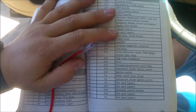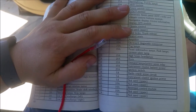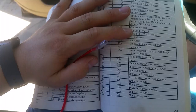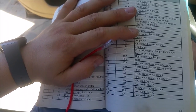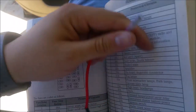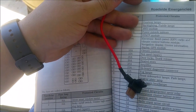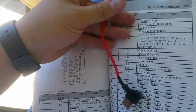If you don't use these, you actually have to find a wire that is 12-volt accessories and 12-volt constant. I'm going to use this for my accessories because I don't feel like sorting through to find an accessory wire, and it will be different on your car anyway.